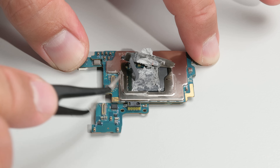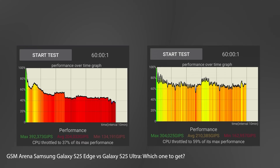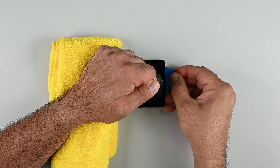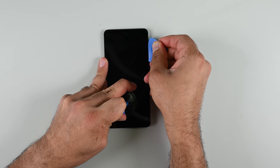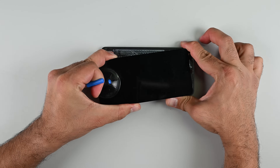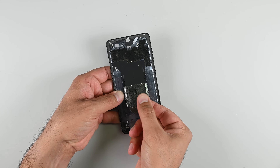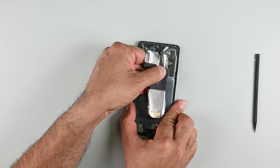All of these thermal materials will be difficult to replace if not carefully preserved — at least until someone provides a pre-cut thermal solution for this form factor. Putting the same powerful SoC in a frame 25% thinner comes at a cost: GSM Arena's thermal tests reveal the S25 Edge throttles performance sooner than other Galaxy S25 phones. Removing the screen — which required heating to just below atomic fusion temperatures — is not easy. It's adhered heavily to the frame, complicating screen replacements. Under the screen we can see a very wide but very shallow vapor chamber dissipating heat away from the SoC and through the screen.